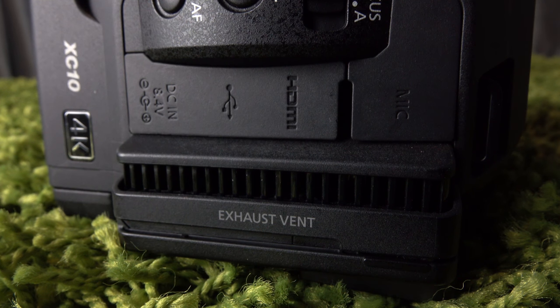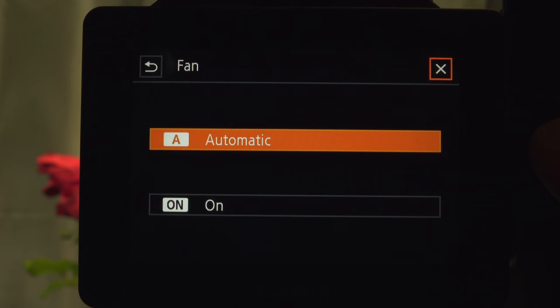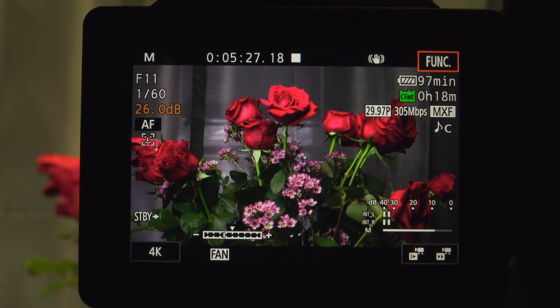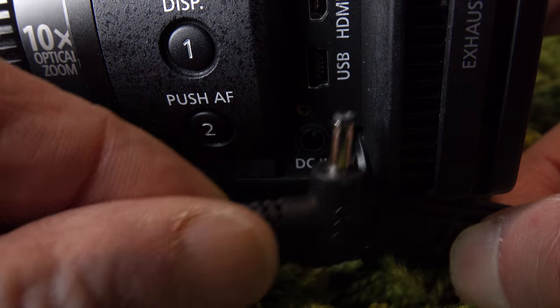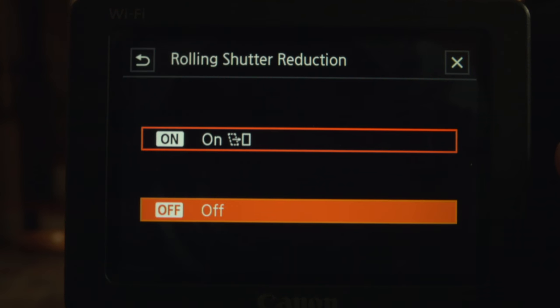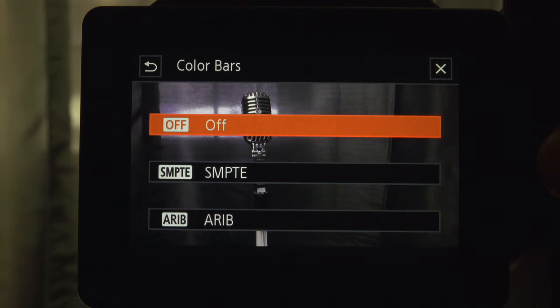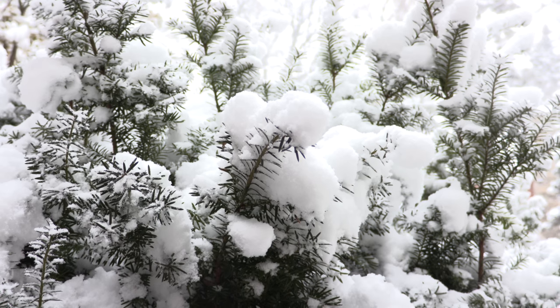The XC10 has a nearly inaudible fan, which means the camera is unlikely to overheat. There is a menu setting that stops the fan while recording, but the camera overrides the setting when it's overheating. Battery life in minutes is displayed on screen. The XC10 has a DC power input, which is used both to charge the battery and to power the camera for longer duration shoots. There's no charger included. If you're noticing rolling shutter effects, a setting in the November 2015 firmware update reduces it dramatically — but face detection isn't available if you enable it. Color bars and tone are available; bars peak at 100, and the camera's output clips at 109.